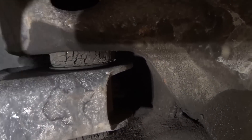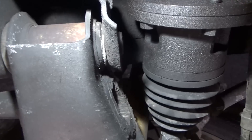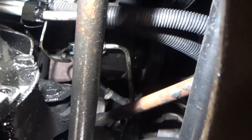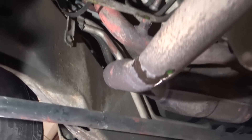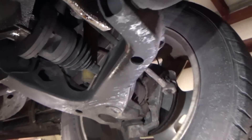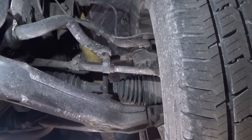So let's talk to Bill and see how safe he wants his wife to be in this, because that ball joint's ready to pop. Other than that, this truck's super clean underneath. It doesn't have a whole lot of rust under it — it's a pretty nice truck for 215k. You can see how the control arm's pushing out in the bushings. Looks like we've got a power steering issue — oh, the power steering pump was just changed, so a lot of this might be residual. This is a clean old body style truck. We've got a little coolant leaking — let's see where that's coming from. Core or heater hose, maybe? Looks like water pump, maybe. On all, a pretty clean old truck — other than the fact the ball joints are ready to fall off. We're going to replace them all because we want Vicky to be safe.